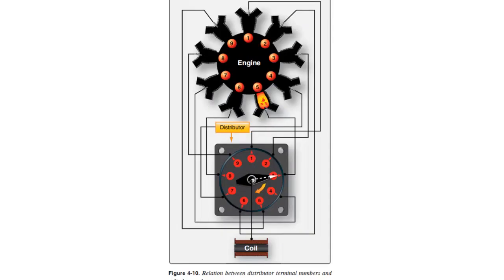That spark happens really fast — we make a whole bunch of sparks exactly in proportion to the engine speed. But each time the magneto produces a spark, it has to send it to a different cylinder. So we have what we call a distributor, which is a rotating switch. It rotates at a speed whereby the tip of the switch aligns with a different spark plug wire each time the magneto fires, so that it sends a spark to the appropriate cylinder each time.